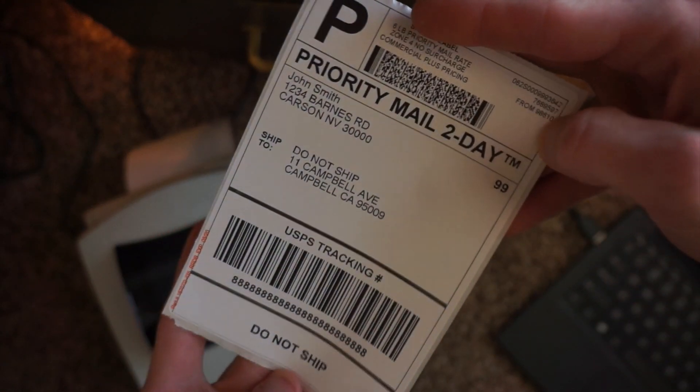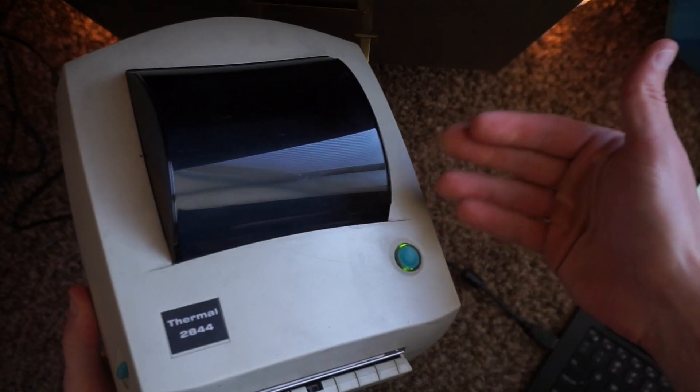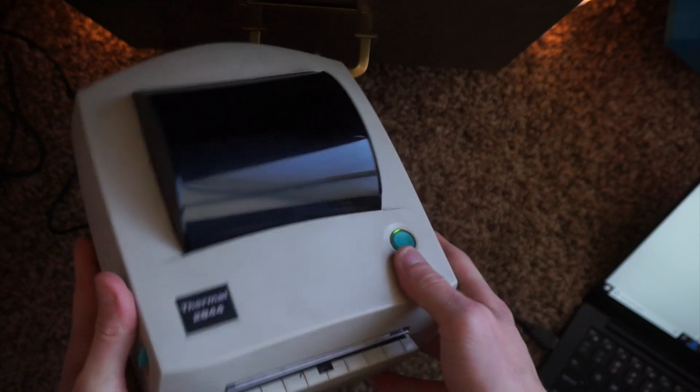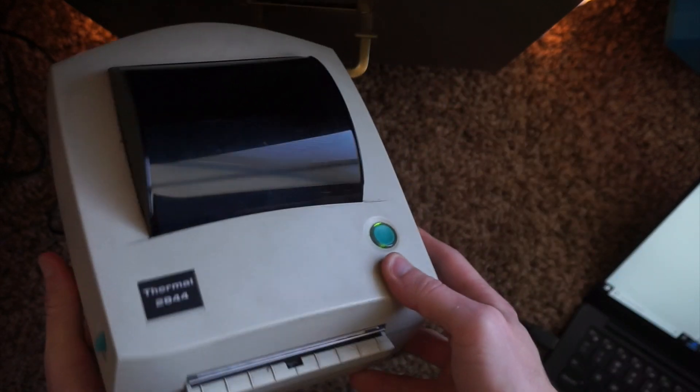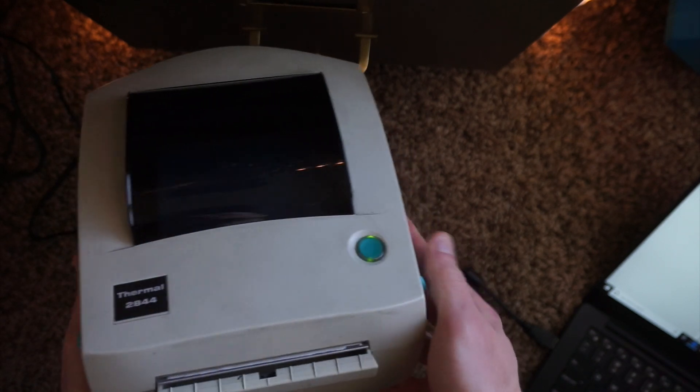That test print looks really, really good. I don't know what Zebra is talking about — this only needing the UPS system — because I was able to get it working perfectly fine on a Mac and on a PC. There is a specific driver for the PC; it doesn't work with the Zebra driver like my regular LP2844 install video. But I'm pleasantly surprised for $25 — another printer, another success. I will most likely be giving this one away at cost. Anyway, thanks everybody for watching. Please give this video a thumbs up. I hope you learned something today because I certainly did — I didn't know the UPS 2844 works pretty much the same as the regular Zebra LP2844, just with a little tweak in the Windows drivers. Thank you guys for watching — if you have any questions, comments, or concerns, let me know and I'll talk to you in the next video.